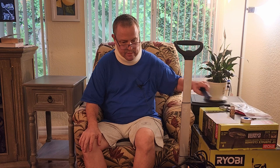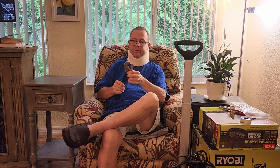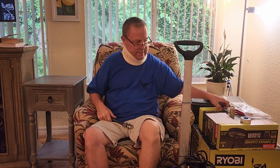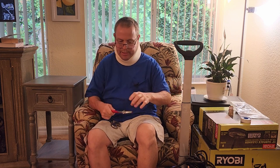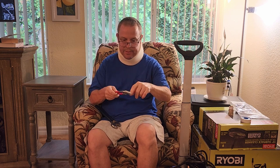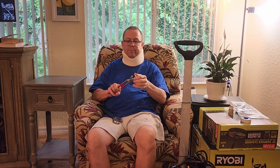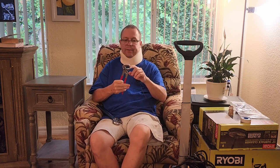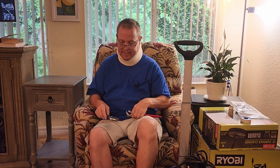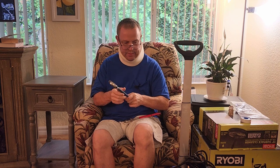The next thing is, when you're working with bolts and stuff, always try to use one of these, or even a, well, it's hard. You can't use a socket because you're coming in from the side. If you use something like a pair of pliers or a ratchet like this, you're going to scratch the metal. You could always put some electrical tape around this and then use that if you want to do it that way. I admit I was guilty of using this. The nice thing about the grip handle here is it's nice and thin, and you see how thick this is? When I was putting the Quick Connects on, I couldn't get on everything. I have smaller, thinner ratchets like this, but even those wouldn't work too well.